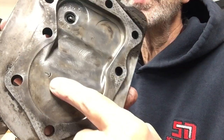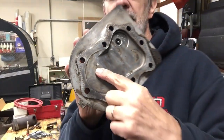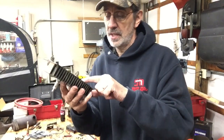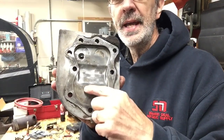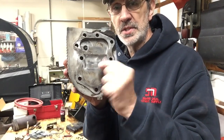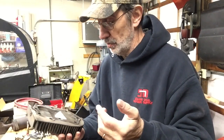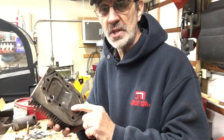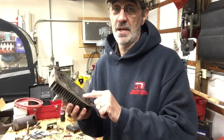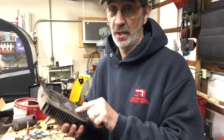But this is on top of the piston. That was probably the screw that broke in half, as when the piston came up and crushed it, the head would have stuck up higher than the threaded shank, and it probably snapped the head off. Maybe he found the head last time, I don't know. But I remember him saying that, so that was from the first time the screws came out of the butterfly. This time I will Loctite them in place.